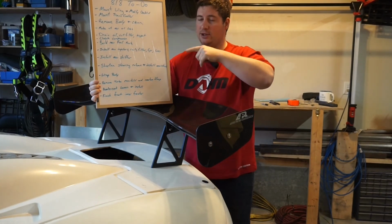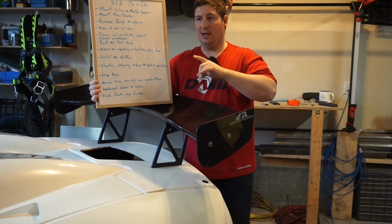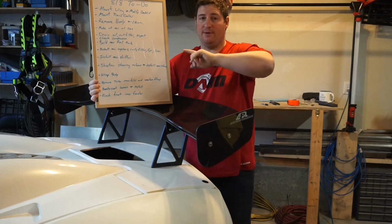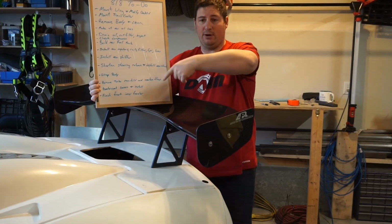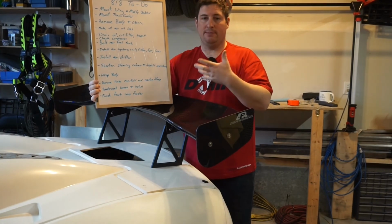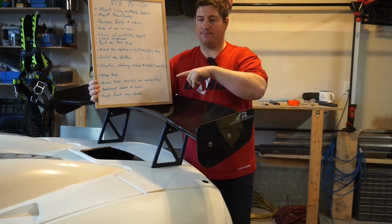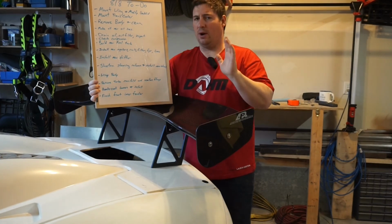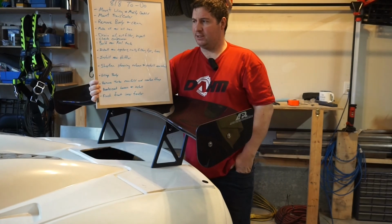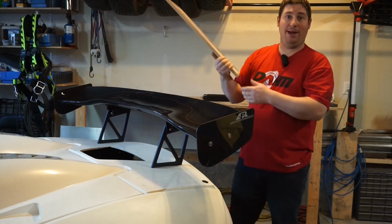a nice permanent line, so that I can bypass the oil coolers should I have an issue like this in the future. And I'll probably make it long enough that I can bypass all the lines going to the front and just run from the front cover to where the oil filter is, should I just need to get home somewhere. I do have a temp sensor, so I could do that cautiously should I have to, because that kind of sucked when that happened. And that's the plan.